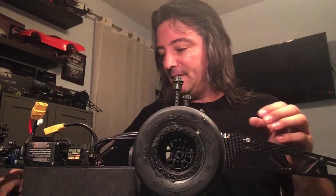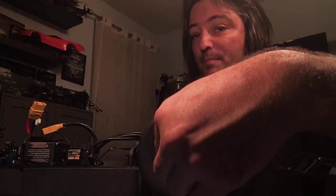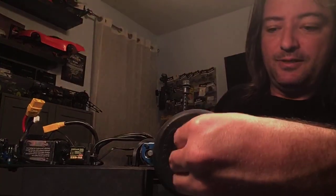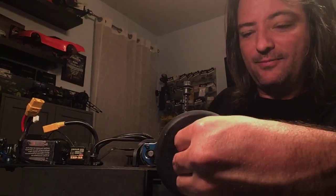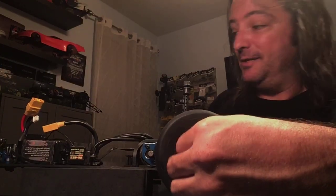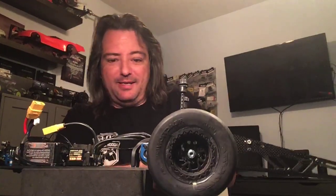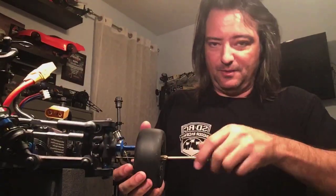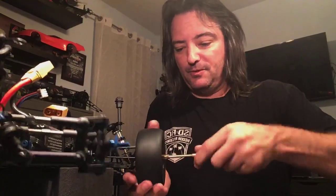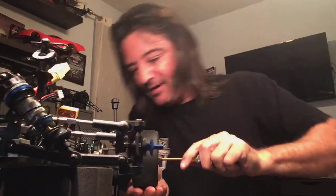At least for the vet body, I think the vet body is probably the best body out there. I tried a couple other bodies, and on the top end, I can't put the power down because you don't have the downforce. I think the vet body has the most downforce, and with the amount of power that we're making now, downforce is good. I tried a standard body, like an Octane body, Friday night, first taking it out, and it would just blow the tires off on the top end because it didn't have any downforce on it. So putting the vet body on it, Coy's road, granted it's a different road, but it put down a ton of power. So I definitely recommend the vet body.